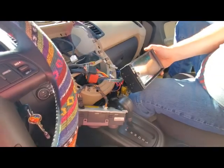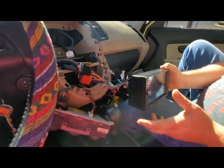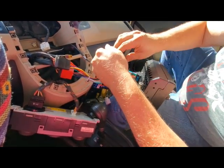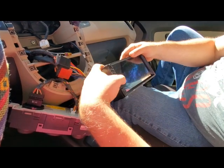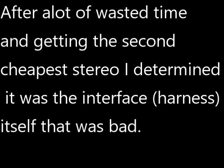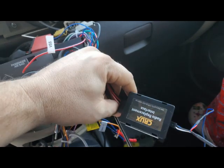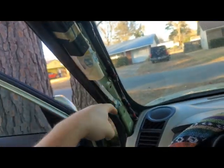While we're at it, let's try the steering wheel controls. We'll try turning all the dip switches to the off position — it does come with instructions on where to put these. In order to hook this up you have to have this Crux box here. To retain the steering wheel controls you also have to have a microphone.